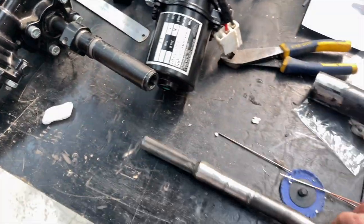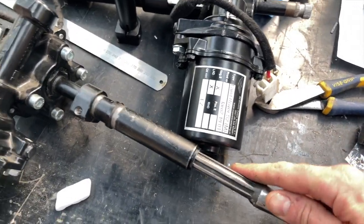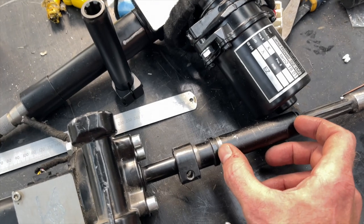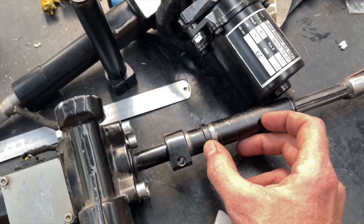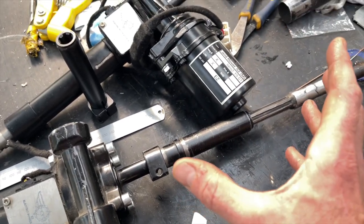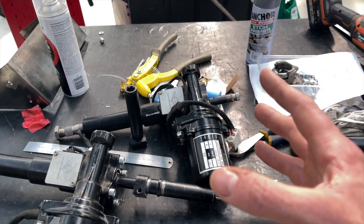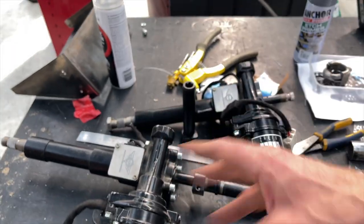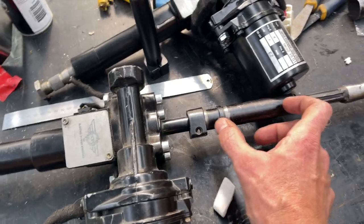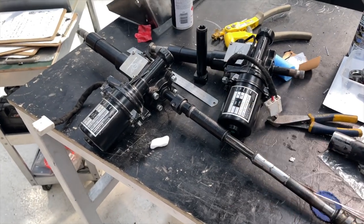They also make all these couplings, so we're able to modify the steering shaft to have this keyway that slides in here, and that's how we connect that to the original steering box. What this also does is gives us some collapsibility. And what old cars didn't have and new cars do have is an area in the steering column where it collapses if there's an accident. The geometry of a Land Rover steering assembly isn't so bad, and actually in an impact it kind of swings away and there's a few rotational elements, and it's not like a skewer like some old cars were. But this just gives us this extra protection because we know that overall it's about 80 millimeters of collapsibility within the column.